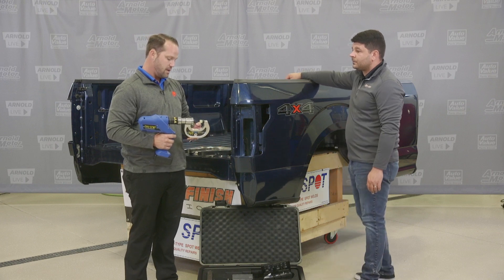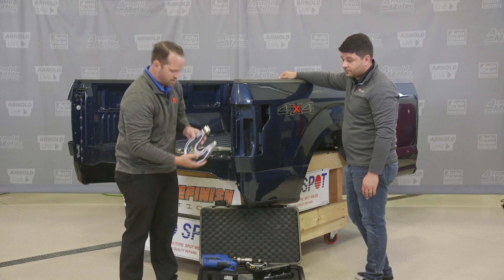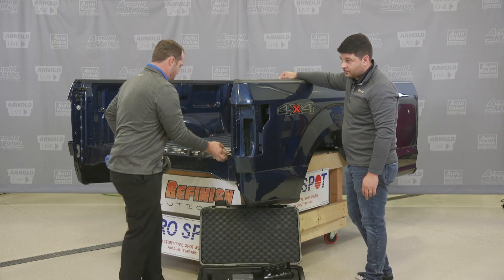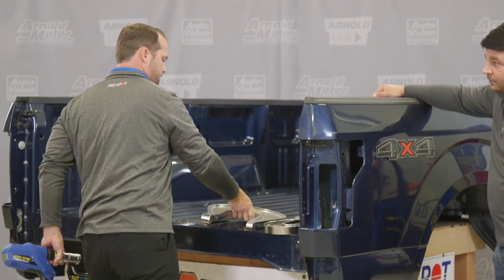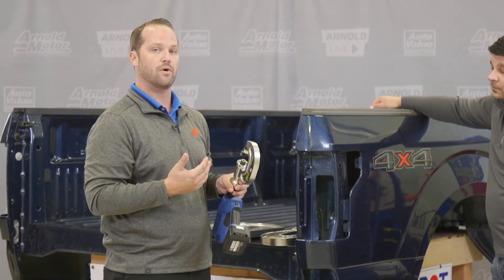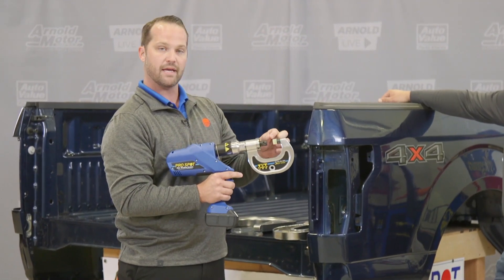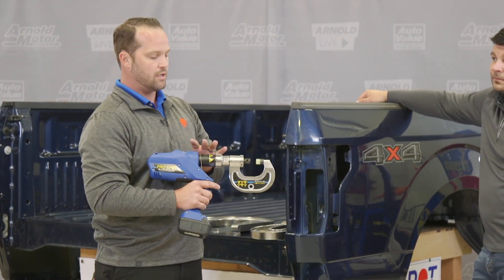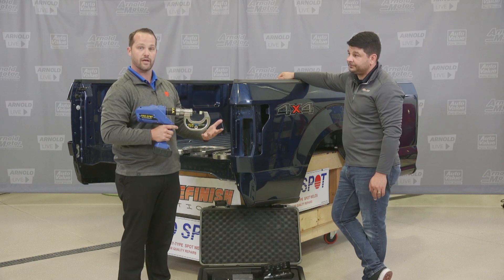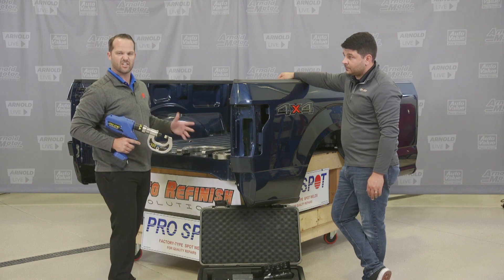We also have the medium-size arm and then the large arm — these are pretty heavy. To put it in perspective for technicians who use a spot welder: a spot welder produces about 1,400 pounds of tip pressure when it comes together and makes a weld. The PR5 riveting system is right at 11,000 pounds. So it's a huge difference between a spot welder and a rivet gun, which is why the arms are pretty beefy and the big arm itself is quite heavy.